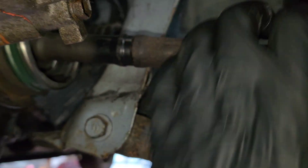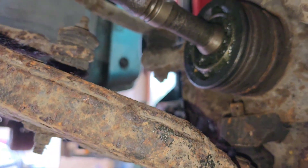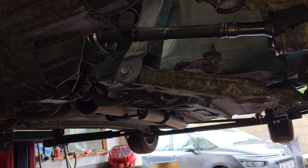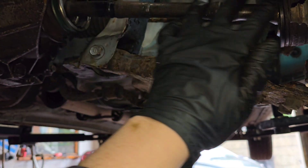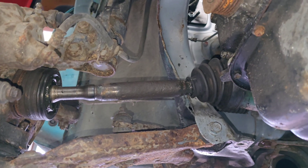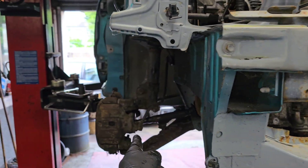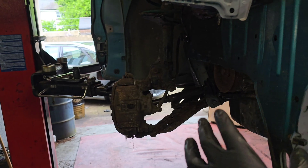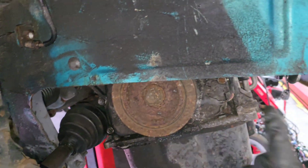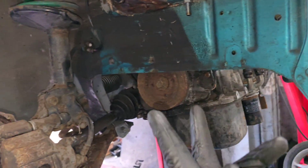That seems alright — yeah, that's perfect. There's still that space there. I'm going to have to send it off because it is a welded drive shaft. That one's perfect, and I think the space between that and the other one should be about the same. So I'm going to test that theory — take out the shafts and then probably try and put that shaft in this hole. Same length between the bracket and the ball joint. If they're both the same length and fit vice versa, I can just send them one shaft and tell them to make two.